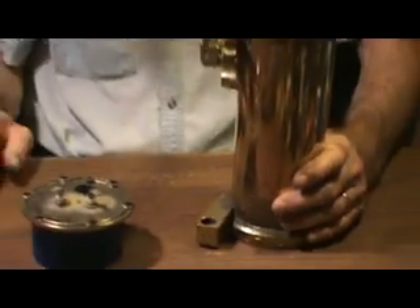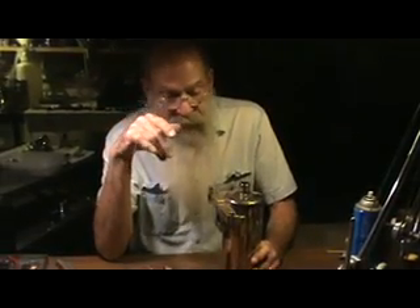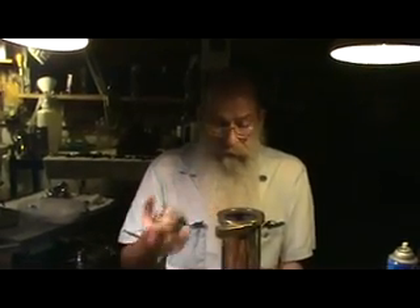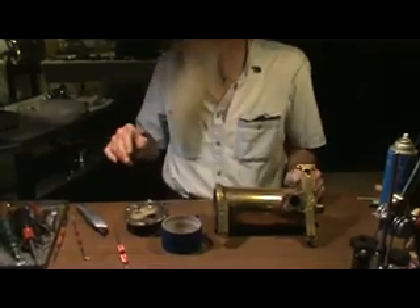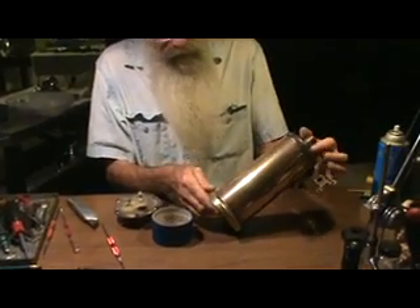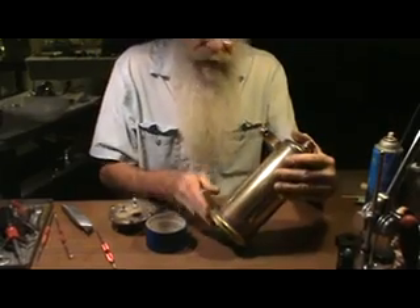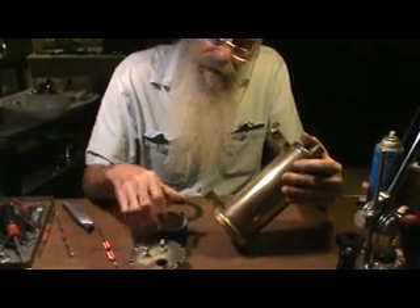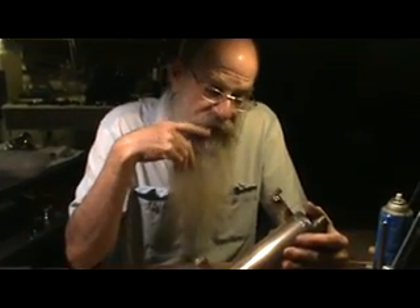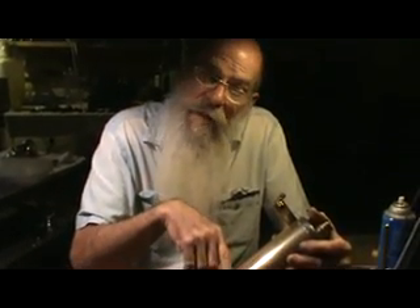If you still have your boiler on your frame, you will install the heating element onto the boiler in the frame — a lot of times I choose to do this upside down holding the frame between my knees. But in this case, since we had to take this off to remove the asbestos, we'll just install it on the bench. Just a few little points here. This had the asbestos covering on it, and that can hide a fairly common defect that crops up in a lot of Olympia machines — the presence of pinhole leaks.